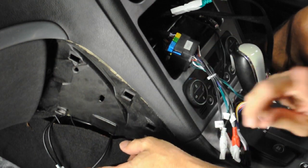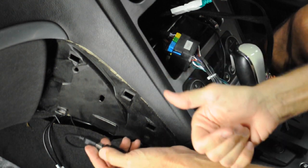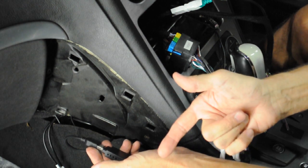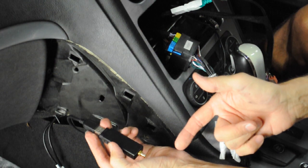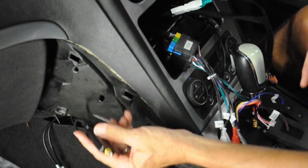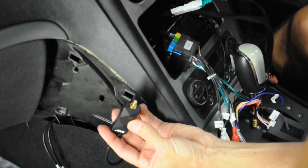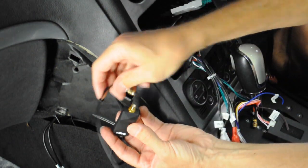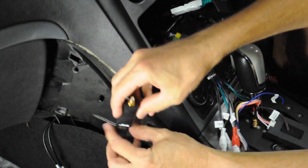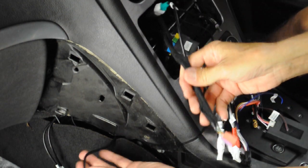You take it out of the cardboard and it sticks to your window. I'm getting an aftermarket DAB antenna that replaces the single antenna on the roof for the 159 — it has AM, FM boosted, and DAB at about plus 20 dB, so I'm hoping to get the reception I need. That's the DAB connector extended and ready.